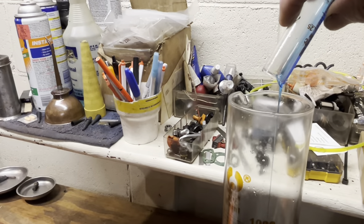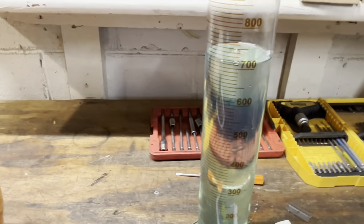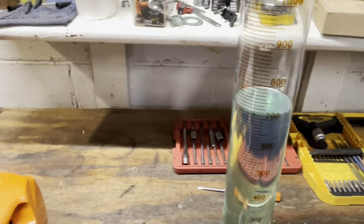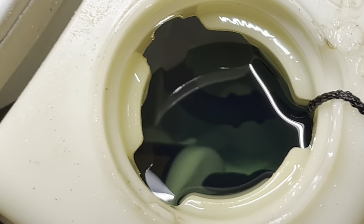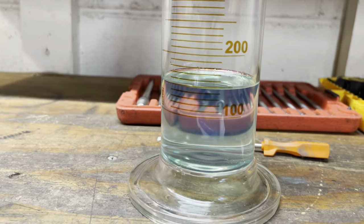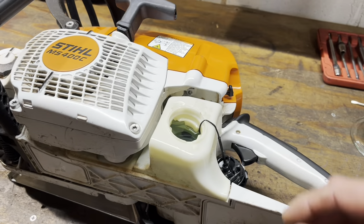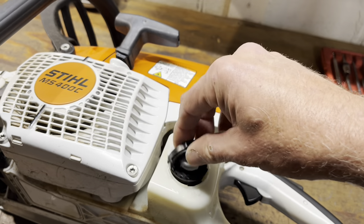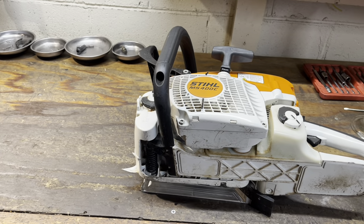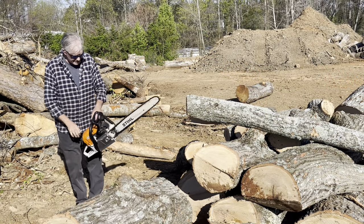It's kind of thin — not horribly thin, but that's barely enough to change the color of the gasoline. I'm not looking forward to this. I'm nervous as a three-peckered goat. Well, I got a full tank of gas — you can sure see the fuel filter in there. I need to remember to mix up a little less; the 400 only holds about 550 milliliters of gas. My 046 that I used for a previous oil test would hold like 700 to 750. Let me get oiled up, put a fresh bar and chain on, and we'll go do some cutting.